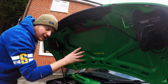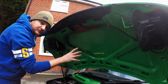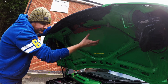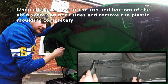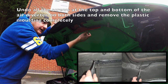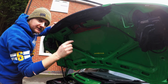So we're going to start under the bonnet. On your car it's going to be a slightly different setup because you will have some sound deadening material — that doesn't make too much of a difference other than it looks slightly different under here. You'll also have a plastic tray that's held on by two screws and two bolts. I'll put a picture up on the screen of where that is and how to remove that — literally two bolts, two screws, take that off.